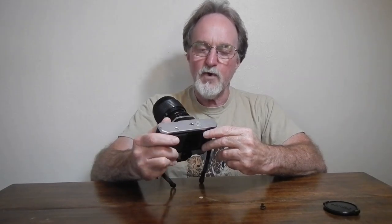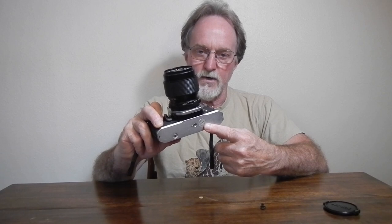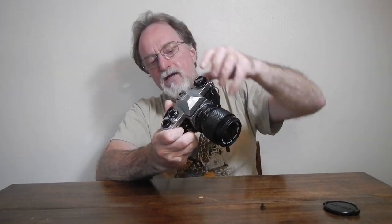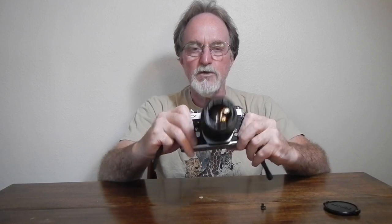It takes two 1.5-volt batteries. This camera is mid-70s vintage, when a lot of companies were still using mercury batteries, but these guys actually put a regulator circuit in here so you can use common batteries — they recommend silver oxide SR44s. The battery check button is up here; press it and normally it'll swing the needle down away from 1/1000th, and if it goes to about 1/125th it means your battery's good. With batteries in it the needle just sort of jumps, which is why I think the sensor is probably loose inside the pentaprism.